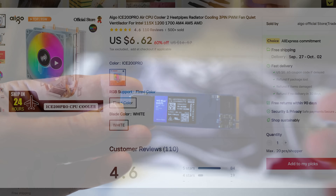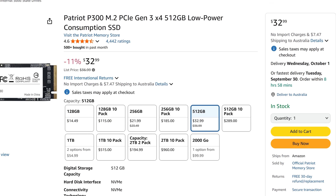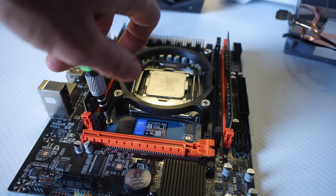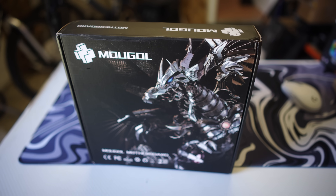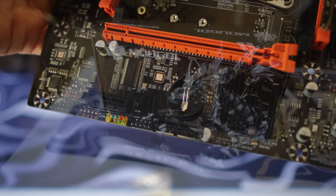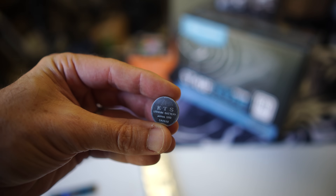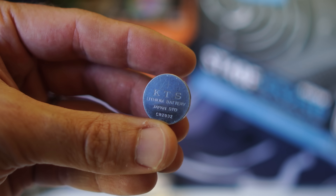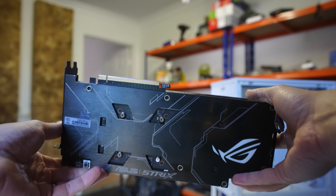For the SSD, we're going with a 500 gigabyte M.2 NVMe, because this motherboard does take advantage of resizable bar, which does help with gaming performance in some titles. That's a great little bonus, and 500 gigabytes should be enough space on a budget like we've got here today. One thing about this motherboard is it does come shipped with no CMOS battery — those are the CR2032 batteries. If you don't have one lying around, I'll put a link in the description below, but they're usually like a dollar, even from your local thrift store.